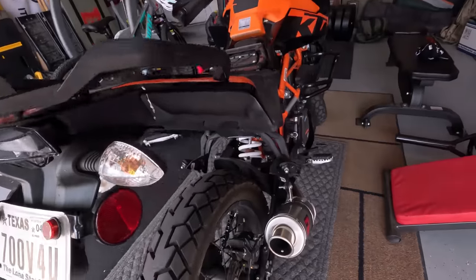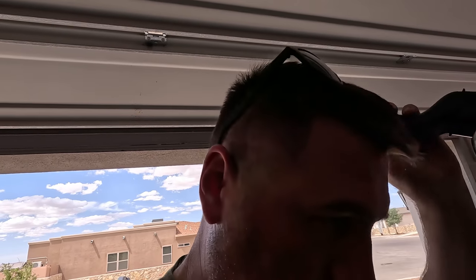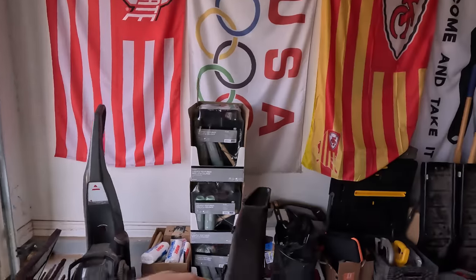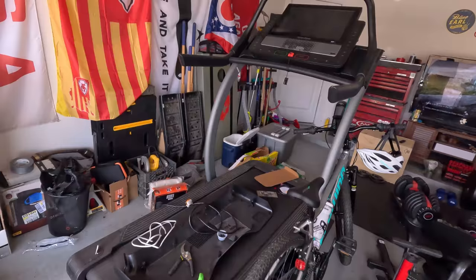I've decided I'm not going to do any kind of pre-filter. I watched a couple other videos — all this is going to be pretty much contained under the seat and then it has to go up through the filter into the engine, so I don't see where I'm going to get a ton of moisture or dirt getting in there. So let's fire it up real quick and see if there's any difference in the sound of the inlet. It could make my bike run more lean, but with the Fuel X that should automatically adjust on the fly. Also you might not be able to hear anything just because this exhaust is so ridiculously loud.